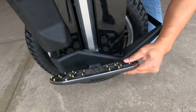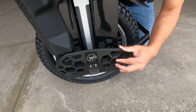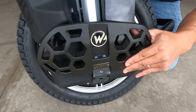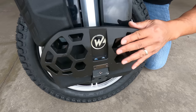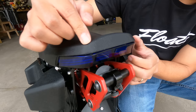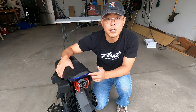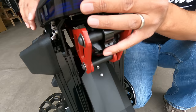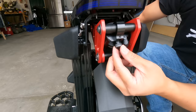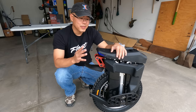You have your two battery packs on the side. I would have liked to see a metal plate here so it's flush and I can use it as a canvas to attach whatever pads I want — Grizzla pads, Clark pads — but because of this design people are going to have to DIY a plate on top. You have more padding below to protect the wheel and the rider. These are die cast metal Begode-branded pedals with spikes — very adjustable, you can adjust the pitch angle and use the grub screw to set friction so they're not too floppy.